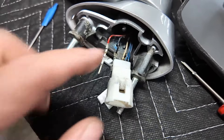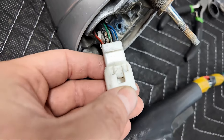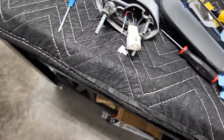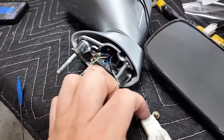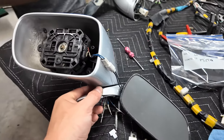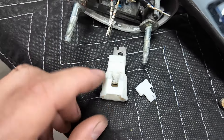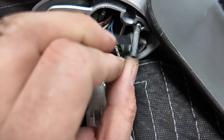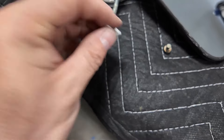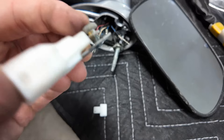That'll show you how to depin it. Three of the wires are pretty easy - red, black, and white. This one is red, black, and then green, and then two blues. I don't know why they switched that but they did. Finish depinning those out and then this should be able to feed out and completely separate so it can be painted and scuffed properly. This is the driver's side mirror - the very furthest one to the right. We put a piece of black tape on it to recognize it. Put it back in the same spot just to be safe.